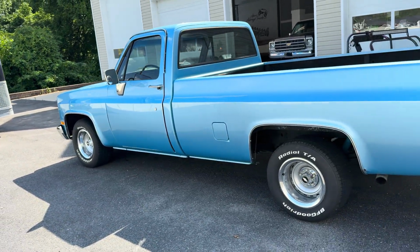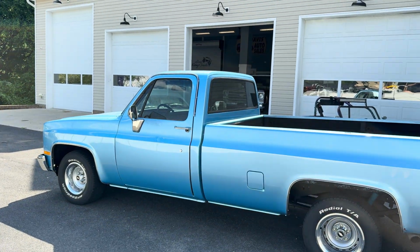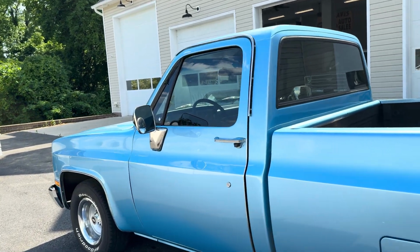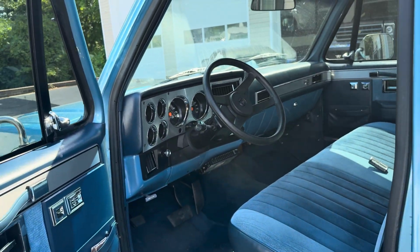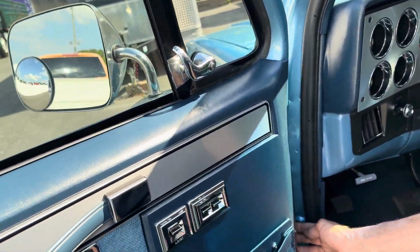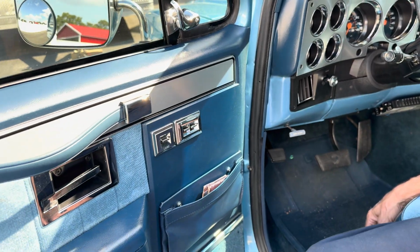Very cool. Long time. Two-wheel drive content, but that interior swap, a lot of people have talked about that. Oh, it's just so easy. It's literally plug and play. You plug two powers into the fuse box and hook up a ground, and that's pretty much it. The most involved part, which most people wouldn't go this far to do, is that in order for it to be OE and have those boots in there, they're riveted, not push pinned, so you have to take the doors off. That was a process.